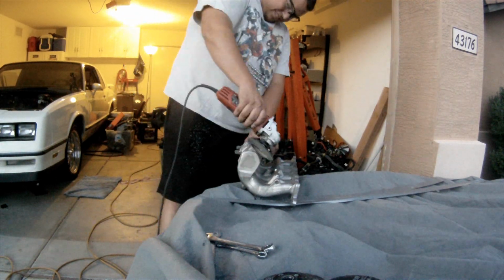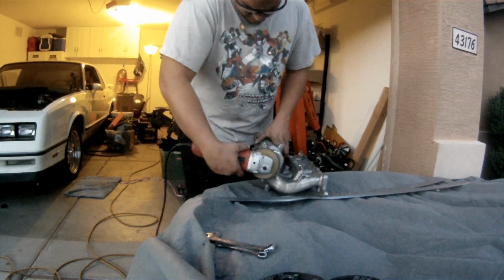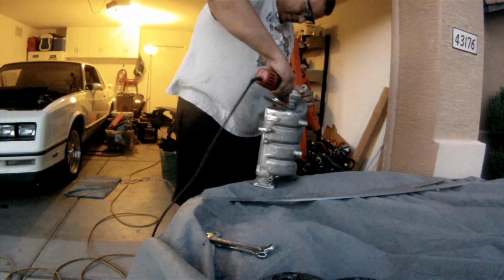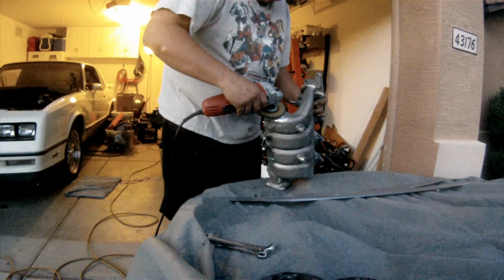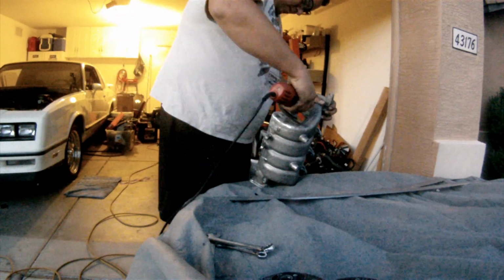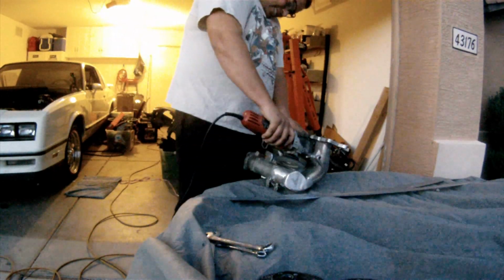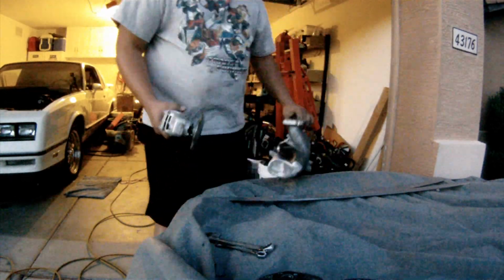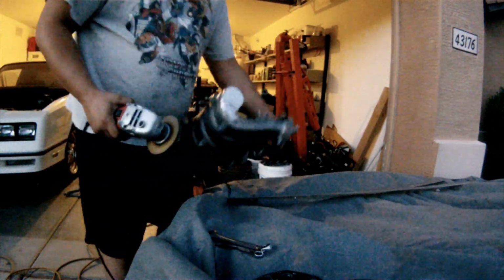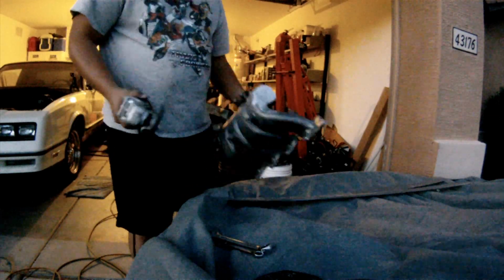And then after I cut off the tabs, I tested out my blending disc to see if it was going to take care of the aluminum real good, and it did. There's no problems. I think it's an 80 grit blending disc, and it rounded it all off real nice and got rid of a lot of the casting marks. When I paint this, there's actually some spots on it that you could tell were ground on. So instead of spending a lot of time sanding it, I just painted it real thick, and then I'm going to wet sand the paint to smooth it out, and then put a final coat of paint on it, and then clear coat it at the end. That way it'll fill up all my gaps, and I think that it'll look good, because it already looks a heck of a lot better right now.